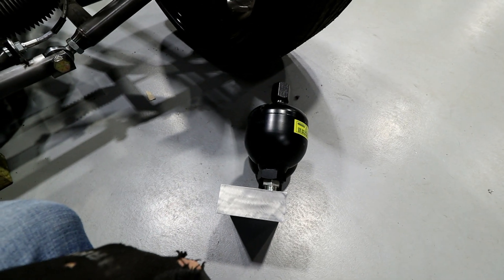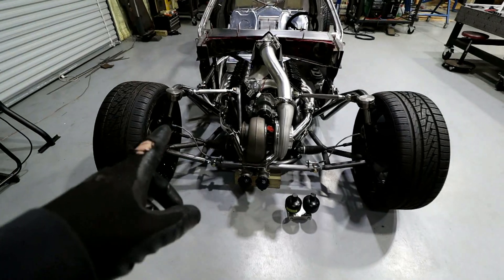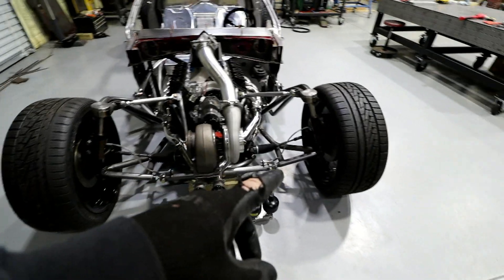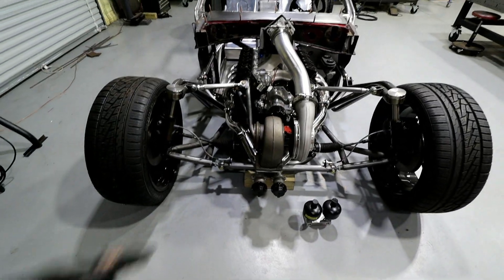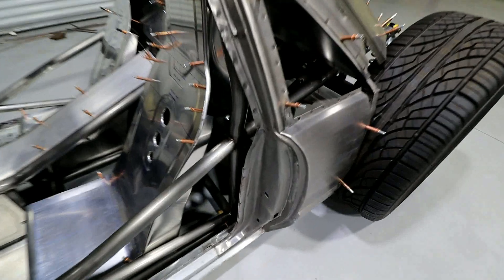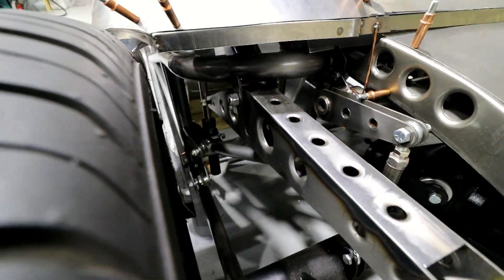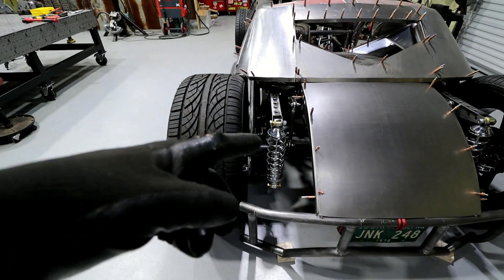It's not the world's best solution — otherwise you'd see these on all kinds of cars — but for something like this it's a perfect solution. Lines come off and run down the chassis on both sides. I've got swivel fittings that go on the bottom of those cylinders, which allow you to turn without binding the lines. Those will go back to the accumulators somewhere in the chassis. I'm going to do a pump in the rear, and the rear section uses the same hydraulic cylinder that ties into a big cantilever — it raises up one side and pushes down the other, essentially raising the car. The rear just rides on coilover shocks, adjusted by hydraulic.